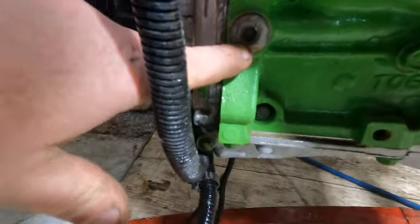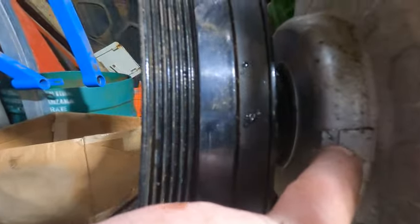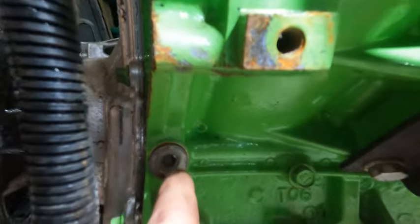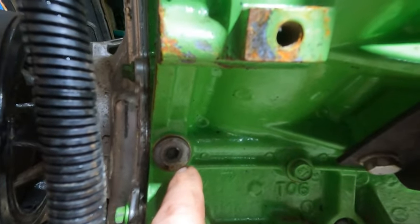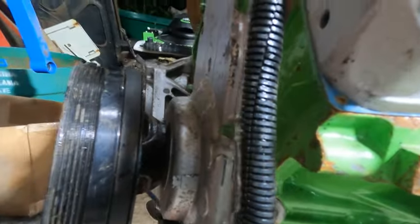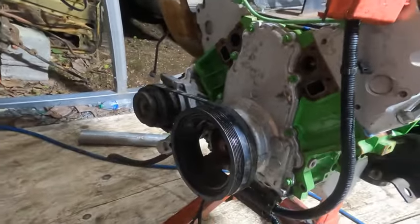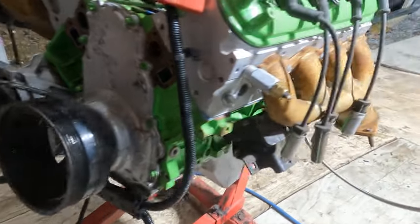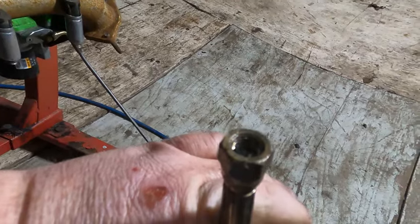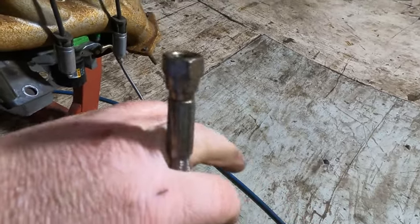I had this oil galley plug opened that goes straight through into the oil pump, which is right behind this cover. I had oil there — there was oil in the passage — but I'm still not getting oil out of the turbo oiling line. I could hear air coming out of it, pumping the air out of the system.